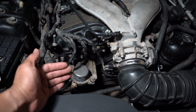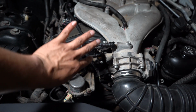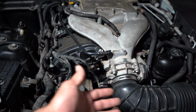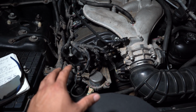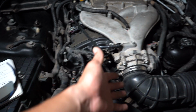So I put the timing chain on, went to phase 2, then to phase 1, and put the timing cover back in. I was done with the timing job. Easy, very easy. It did not even take me more than 4 hours to do to this engine. I know it sounds a little intense, but it was pretty easy. With a couple of beers, I enjoy doing this stuff.